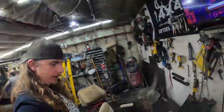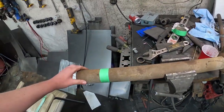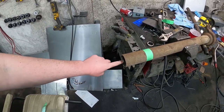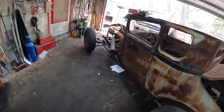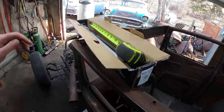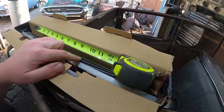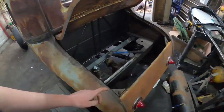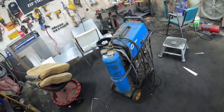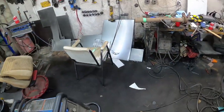All right, car's running minty. So this is my drive shaft. It's like, I don't know, 2.5 or 2 3/4 opening. The shock body is just over 1.5 inches round, so it should be okay. It's just going straight up and down, so it won't have a lot of slop side to side. All I did was measure. It was 4 inches.